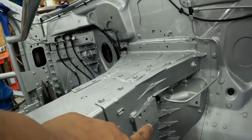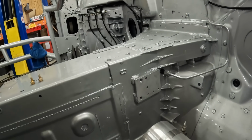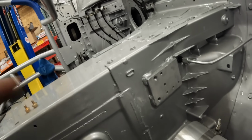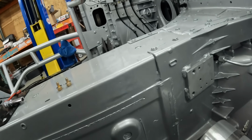We have a spot right here on the car. I know it looks silver, but it's actually bare metal, so of course that's how it's going to lift ground. Matt made this thing welded to the chassis, goes all the way through, and we're going to have another ground cable that runs all the way through the back. This thing's pretty sweet, so let's get that thing mounted up.